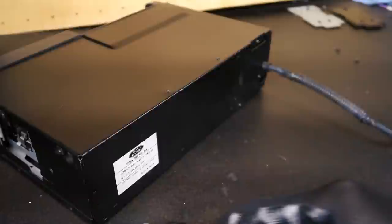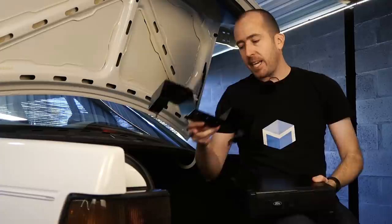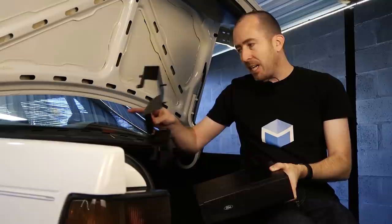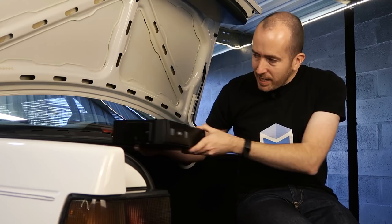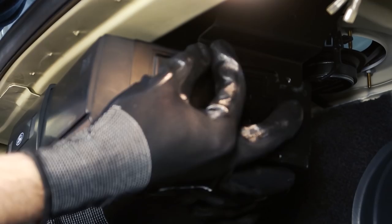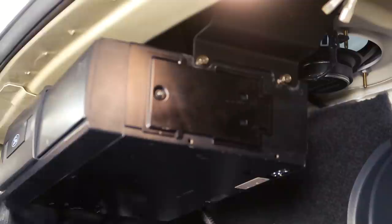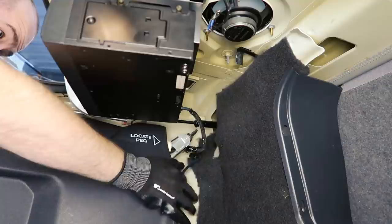I've reassembled the stacker and it's time to install it into the car. For the $100 I paid, this kit actually includes the mounting bracket so that it can be installed up under the parcel shelf here in the boot. Thankfully my car still has the existing bracket in place, so all I need to do is grab six of the supplied screws, get this thing up into the bracket and screw it down. Installing the stacker into the mounting bracket is actually incredibly easy — there are two screws on either end and then an additional two which screw into the top of the unit. Now that I've got it tightened down I just need to reconnect the cable and then tuck it back in behind this plastic cover. And that is a job well done.